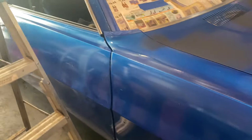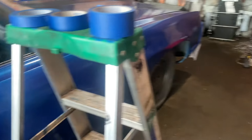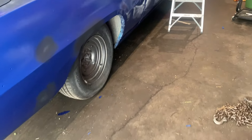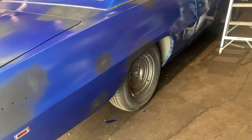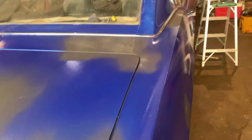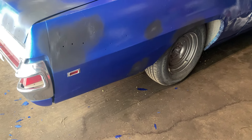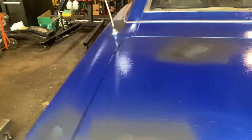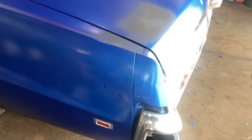It's really just a touch-up thing from my point of view, but I guess it's a little more than that. For bodywork, I don't use Bondo — it's steel only. So doing bodywork, you're not just rubbing on some stuff and sanding it off. If you need your welder, you got to cut it out nice and clean. A large part of that fender right there I've actually replaced — turned out pretty good. The first time wasn't quite as nice and neat. Over here I did that when the bottoms rusted out.